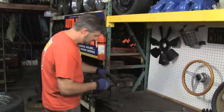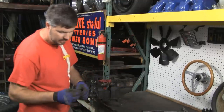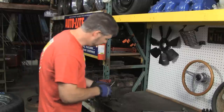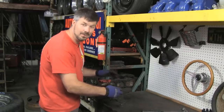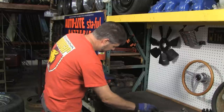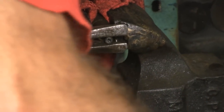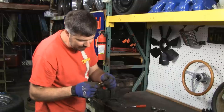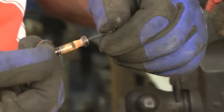If you can't get it out like this, you've got to move to step two. Put it in your vise, squish down, get a drywall screw — fine thread. This is what I had handy and it usually works. Just a few turns. If you go too far, you'll break the screw in there and then you've got a whole new problem — just a few turns. It moved! Look at that — right there, that crusty rust-colored stuff — that's the remnants of the spring. So obviously this wasn't doing its job.